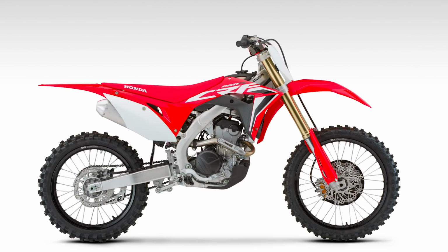So the HRC guys, of course, have made this style of transmission for the Geico team specifically for Supercross reasons. They had a taller second gear, which closed that gap to third, and that's what they've gone ahead and done for production. So I'm pretty stoked to see that. We're going to have a little bit easier movement from second to third gear now.